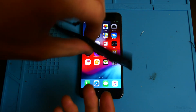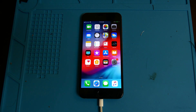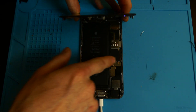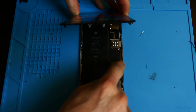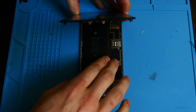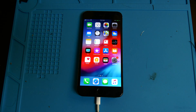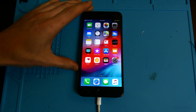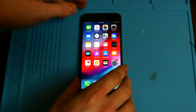The battery actually wasn't physically damaged, but it looks like when water got into the phone it shorted the battery out — it's reading 0.0 volts, so there's no life in it whatsoever. The main extent of the water damage is around this area here, which on the back side of the board is where all the RF ICs are soldered on. There's some corrosion around that area under the EMI shield. I need to clean that up — I'm going to use the highest strength rubbing alcohol I can get, either 90% or pure, to clean those chips and see if that resolves the signal issue.